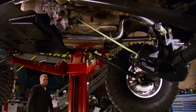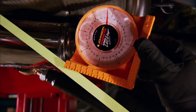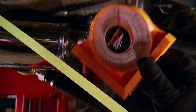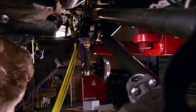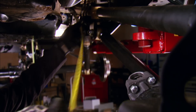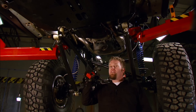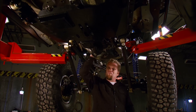Using tape as a guide, we measure from the rear axle input flange to the transfer case output. Then by dropping an angle finder onto the tape line, we know the maximum operating angle the shaft will see. On the front, we just measure the length because the angle is low enough due to the distance from the transfer case to the front axle. Then we call the guys at JE Reel, give them our two lengths and the rear shaft angle, and they'll build us two perfect driveshafts for our TJ.